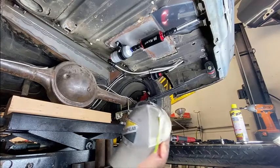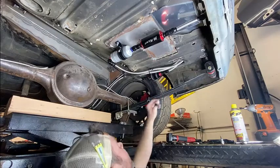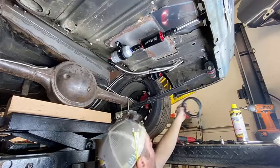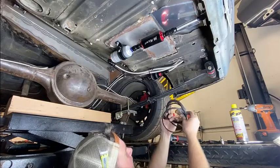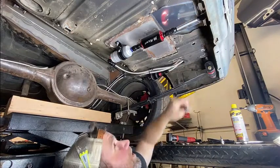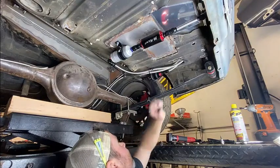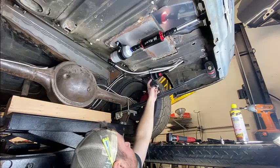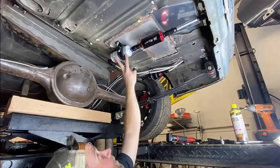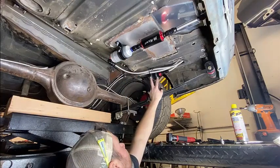Tonight or today or whenever you're watching this, I got the filter in and mounted it, and then I had some fender gasket, it's a rubber stuff. I put it around there so it won't rub the stainless, and that's ultimately what this is for. I put a clamp off of the mount, and also what you saw me earlier doing was cutting a radiator tube, like I was telling you, because it's not as big as the Bosch 044, so you need a little buffer there, and I got that in.